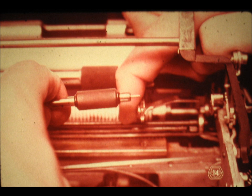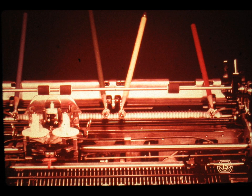On later machines, the feed rolls no longer come out that easily and it would be perfectly alright for you to leave them in the machine for the time being. However, if you must take them out, you can simply pry one of the arms a bit and then get them out. Be very careful not to force, in order not to break off the small ends of the feed roll shafts while doing this. Once you remove the feed rolls on the new style machine and you wish to move the carrier while working on the machine, you should use rubber bands or some tape in order to prevent the feed roll support arms from interfering with the movement of the carrier.